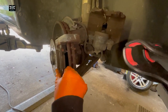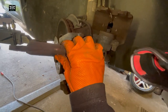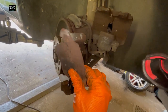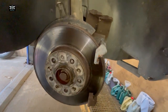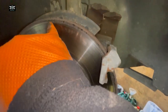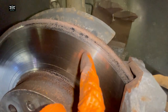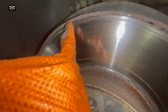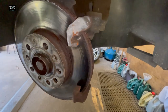Hanging it there, trying to keep the hose without stress. Now we want to remove the other pad. You may be wondering — my pads look like new. But the reason I'm changing them is because I'm changing the disc. The disc is corroded and it's got quite a bit of corrosion all around, and that's why I'm actually changing these discs.